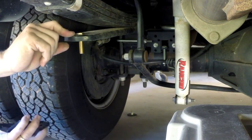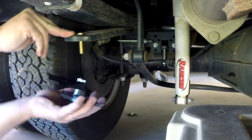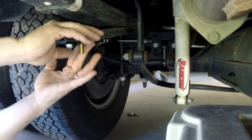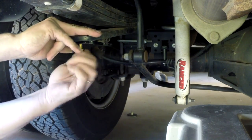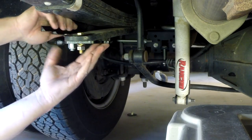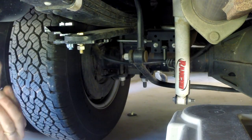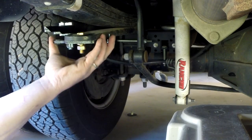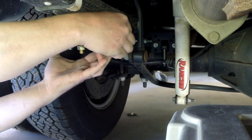You want to measure the thickness of each spring and compare that to the thickness of your washers, because the spring thickness will change from front to back — at least it did on mine. We're going to install this bolt but not tighten it down yet; we want to get these two little bolts started first. With just one bolt in position this moves all around, so you take the little bolts and feed them up through the spring — that holds everything from being able to move.